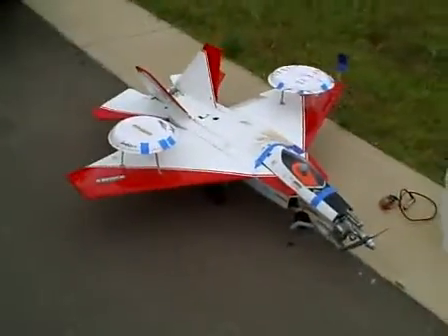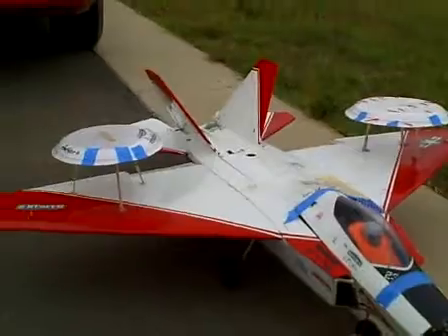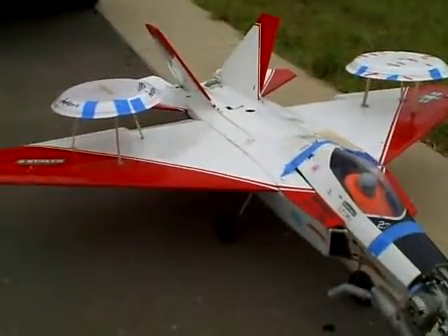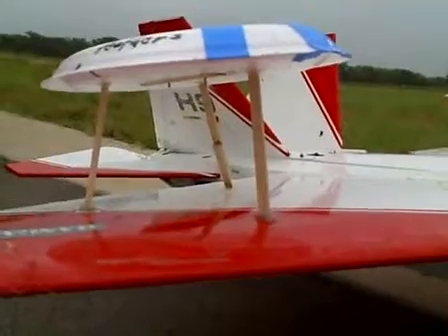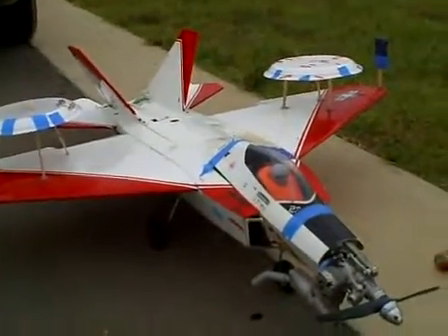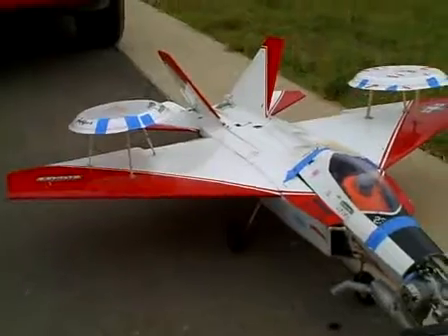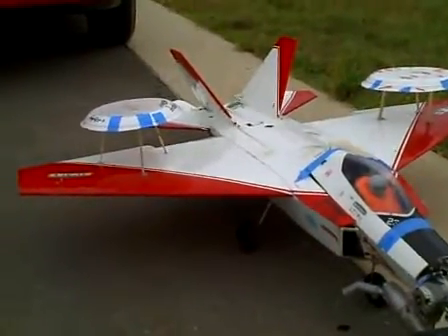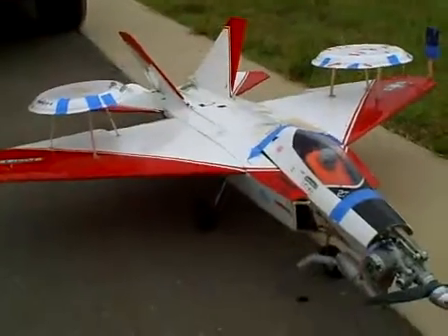Here we have the Hamilton No-Bias laminar flow wing adaptations. This aircraft is a good example - we have a quarter scale coming up, but here's a good example of the Hamilton No-Bias laminar flow disclets being used on this wing. It's a fairly simplistic approach to put these disclets on, but what we're going to see in the videos that follow is that on this aircraft, which is very draggy to begin with, we're adding what normally in aeronautical language would be counterproductive - it looks like we're adding more drag.